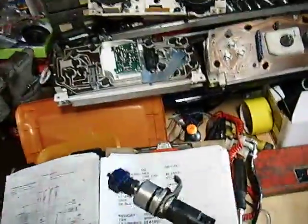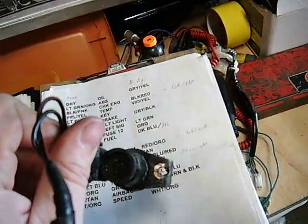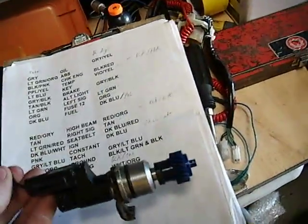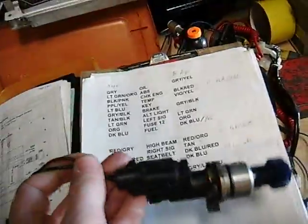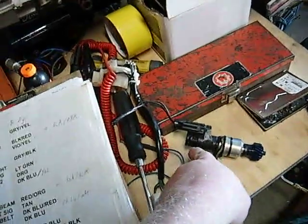It's very simple. The one I have here for an example is actually a Ford one, but it's very similar — I don't have a Chrysler one on hand. One 10-millimeter bolt right down at the bottom of the transmission housing. Take the connector if you can; it makes it easy. Different wire colors than the Ford one obviously. Right out of the speedometer sensor there's going to be at least two wires, sometimes three.